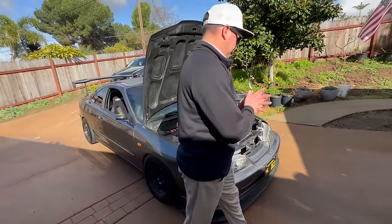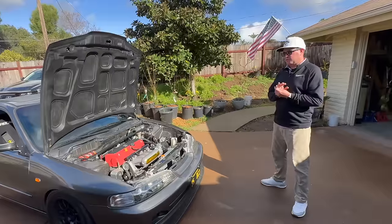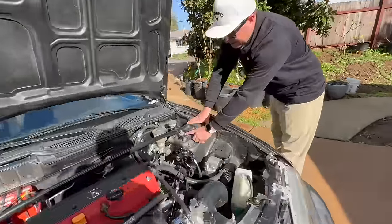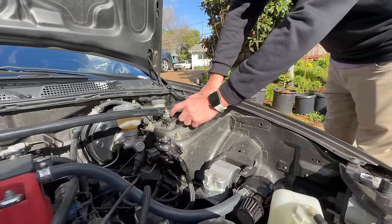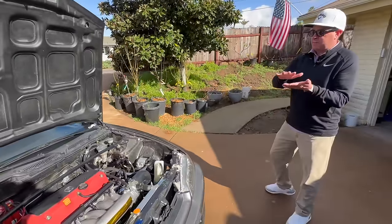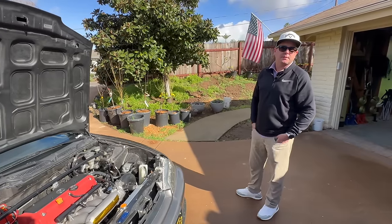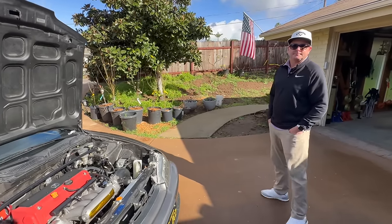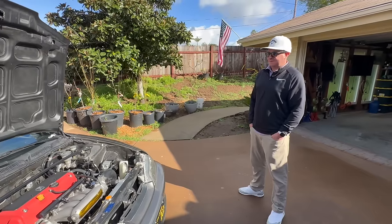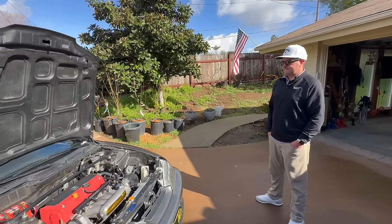I know a lot of guys run Koni yellows with Ground Control — that's what this car has. Koni race with Ground Control coilovers. You can actually get a Type R or NSX top bushing, drill it out a little bit, and it really locks the top hat in. They come with just an all-rubber bushing, but the Type R/NSX one has a metal reinforcement. With the Koni race you have to drill out the shock tower slightly because it's a bit bigger. There are always little tricks like that — pulling a part from a different chassis, just drilling or honing something out to make it fit.